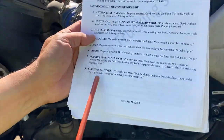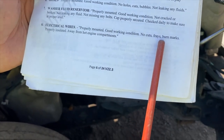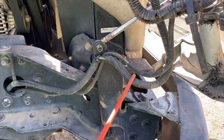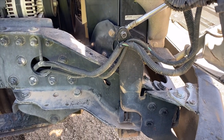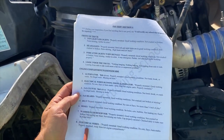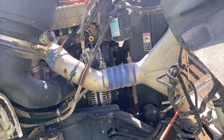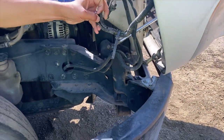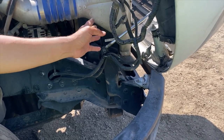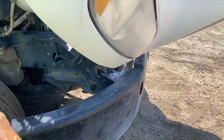Lastly on this side, electrical wires — properly mounted, good working condition, no cuts, frays, or burn marks, properly insulated, away from hot engine compartments. Point to the wires here. That's eight items on the passenger side. As you can see, the wires are properly insulated — there's a wire inside but it's properly secured and away from the hot engine. Now we move to the driver's side.